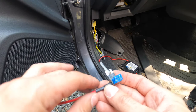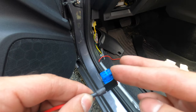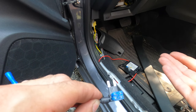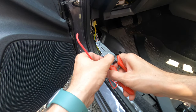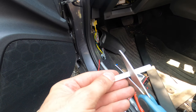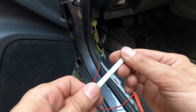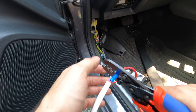Okay, so here's our fuse tap. I have two fuses in it. The factory fuse doesn't fit the adapter, but the kit comes with 15 amp fuses and you get like 10 of them. The back one is the fuse actually powering the power wire and the front one is the fuse that powers that circuit. Before we connect this, we just want to wire it up. Grab your wire strippers and strip off about a half inch off the end of the wire. Give the wires a little twist to make sure everything stays put. Grab your heat shrink — I'm cutting it in half because it's a little more than I need.